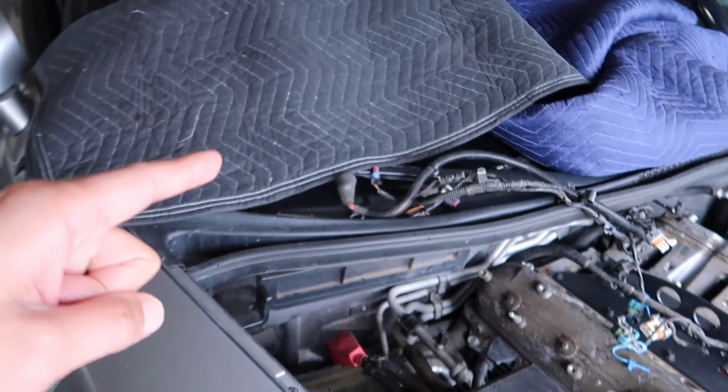Alright, so this is the bell housing. In here is the spline, and if you look, there is a clamp on the actual spline, and that is the other end of the bolt, so I can't unlock that. I can't loosen that up from this side. But I couldn't turn the motor because in automatic you cannot put it in neutral without having the car on.